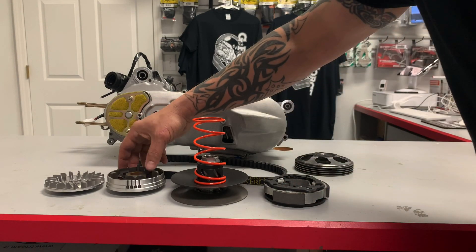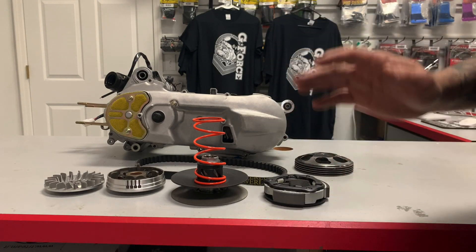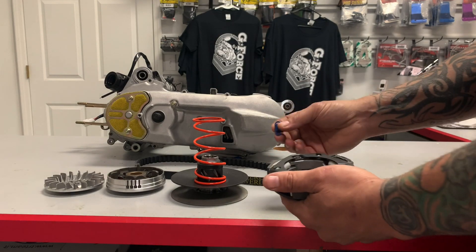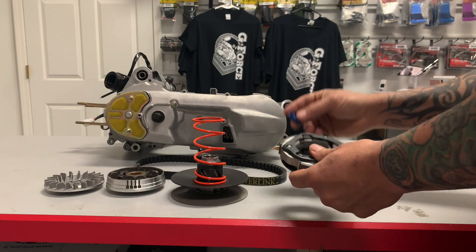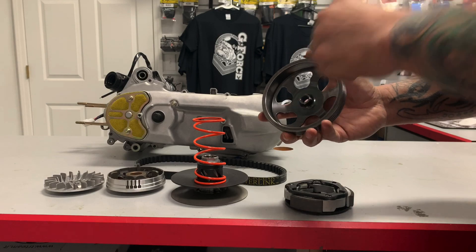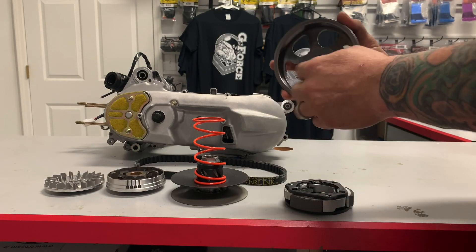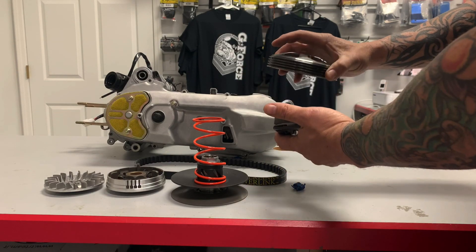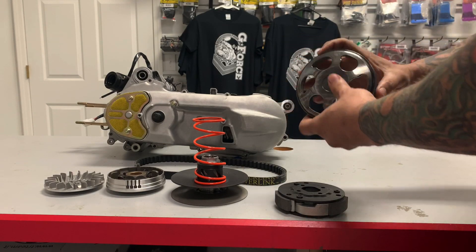The clutch weight and shoe springs are the biggest items that dictate your stall. If you change your roller weight or belt length, that can affect your stall as well, but we're trying to define what each component's job is. The clutch and clutch shoe springs set the clutch engagement RPM. The bell — and a good quality bell is very important for cooling, better grip, and no slippage on takeoff — it's splined and connects to the transmission, so when you have positive engagement with the clutch, you now have positive engagement to the transmission.